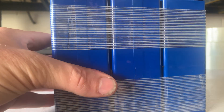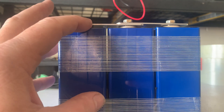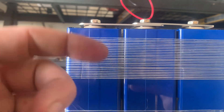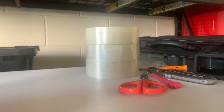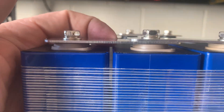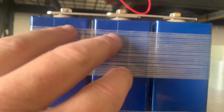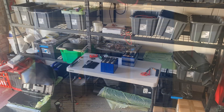We're here trying hard to please and make the best of the situation. Big Wheel Batteries up in Springwood, Queensland didn't have the correct foam between the cells, so we improvised. We've got this very strong fiberglass-type tape and wrapped two bands around each end. In between we've got rubber at the bottom and top which gives the correct spacing for these bus bars. Air can flow all the way through the cells to cool them a little bit, and we've got anti-vibration and stability from the rubber spacing.